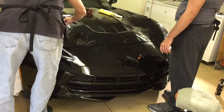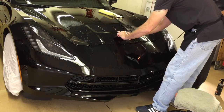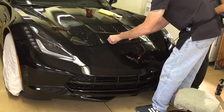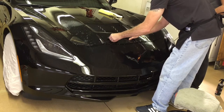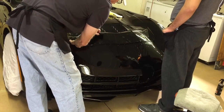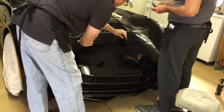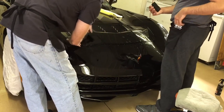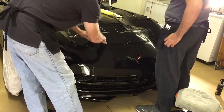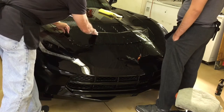You need two solutions and a squeegee. The solutions are a slip or glide solution so your squeegee can glide over top of the film without scratching it. It's also a float solution for the film itself — as you put it on the surface before you apply the film it can float and you can adjust the piece back and forth. I like to tack in the middle, tack at the ends, and work from the middle out to the ends to get the solution out from underneath and let it cure. You want to work out all the bubbles and make sure it's perfectly clean. There are a couple different ways to flush the area — clean it first and then flush it to get the lint out from underneath your towel. You want no dust or lint or anything underneath the film before it's laid down on the panel.